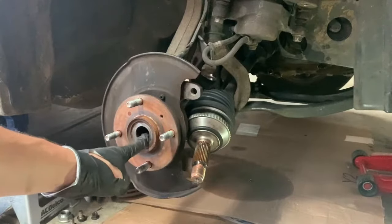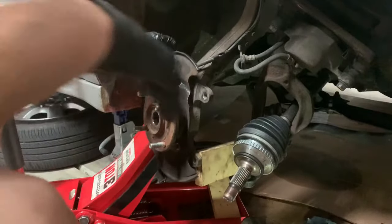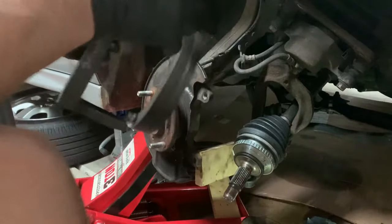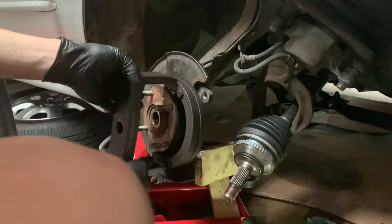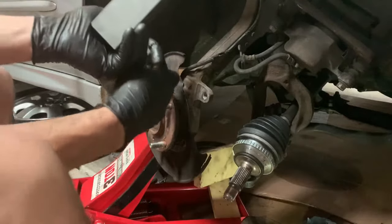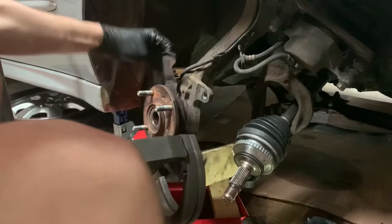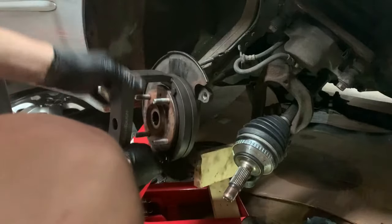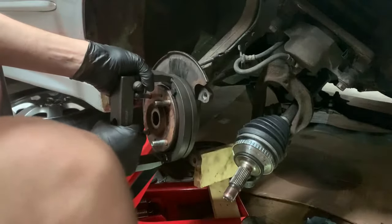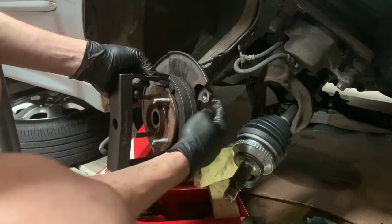We are now ready to press out the hub, and then once we have the hub out, we're going to have to cut the inner race off. There are three screws that hold this little shield on. I recommend taking them off because you have to put this bracket behind the hub in order to pull the hub out. You can see how much more of a lip that adds to go back behind — without that, there's only this and then directly underneath are the grab points. It kind of messes with the flush surface that this horseshoe adapter bracket wants to find behind this wishbone.